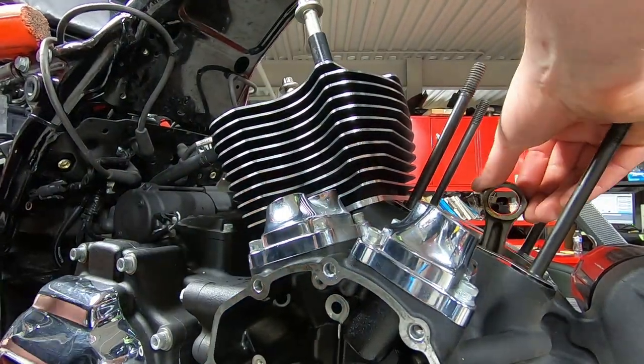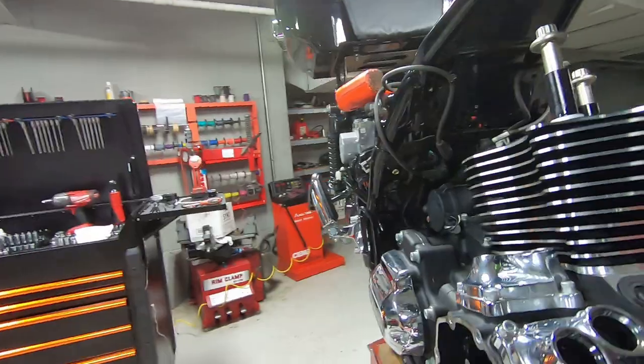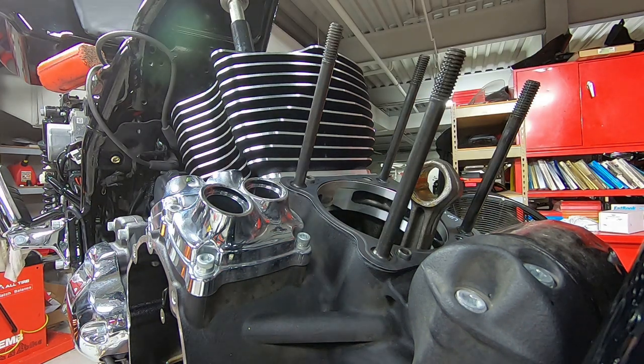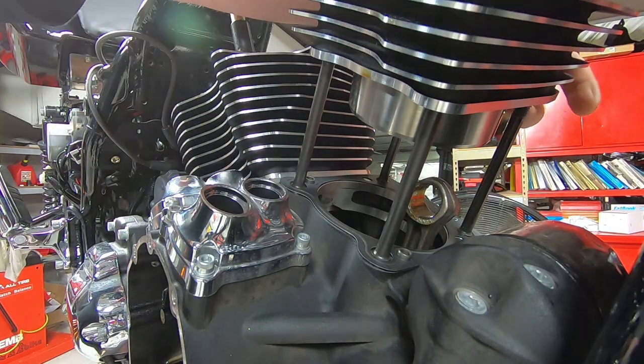And I had just a bunch of these little black spacers laying around that were slightly smaller, so I pressed them on the head bolts as cylinder hold down tools, I guess. Just making life easier. And gotta save up that money for the Jim's lifter tool. Here's a slightly different view of it happening for the front cylinder.